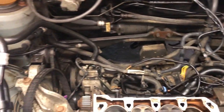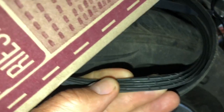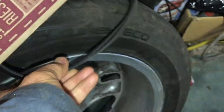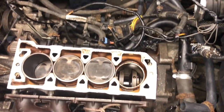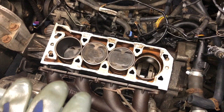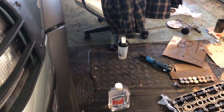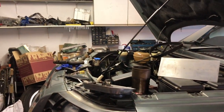The only other thing that comes to mind: check the overall condition of your belts. There are a couple of belts to be removed — where they're really bad, you'll see lots of cracks when you bend them the other way. That obviously needs replacing. I've got a new belt to fix that. Better to replace it now than wait till it snaps, potentially creating a lot of damage. So that's my list of do's and don'ts — extra things worth sharing on the K-series engine build. Good luck with yours, and hopefully at some point I'll do a video on converting a Freelander to a 1.8 turbo engine, upgrading it to 200 horsepower. Thanks for watching!